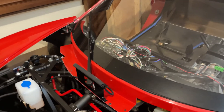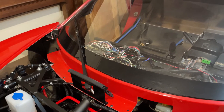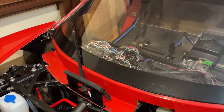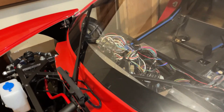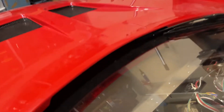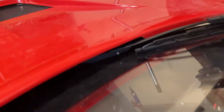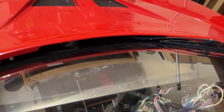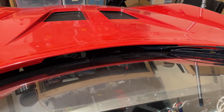I don't have full functionality of the Subaru system — I don't have intermittent anymore, just a low and high setting. I did have to cut out the back of my hood a little bit; you can see that cut on that side, all the way to there. That's just to allow the arm to sweep back and forth.